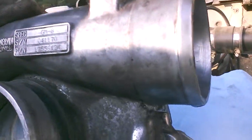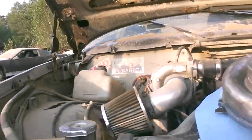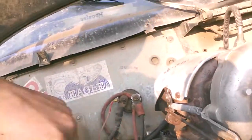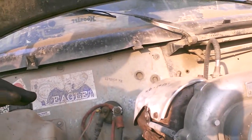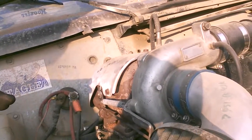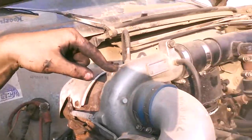You might be able to see it — GM8. I thought it was a 9. I would change the whole turbo, however this already has a custom flange welded on. This is the older style with the wastegate in the turbine housing. It's already hooked up, everything's clean, the bearings are beautiful. So all I need to do is pull this front assembly off and put that one on.